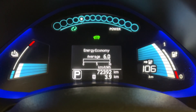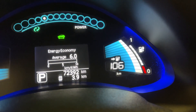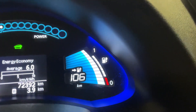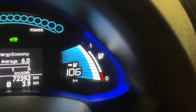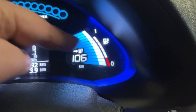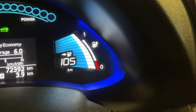This information is for any older Nissan Leaf from 2011 through 2017. This is what your instrument cluster looks like, and on the right-hand side is where you'll look at the battery health level. This display shows two different things: the blue bars with white nubs on the end show the current charge level of the battery — there are 12 of those bars, and all 12 are illuminated, so this battery is at 100% charge.